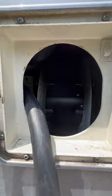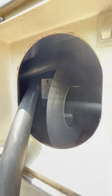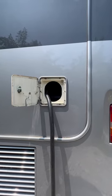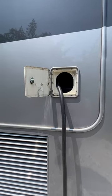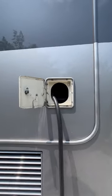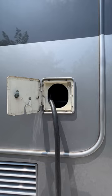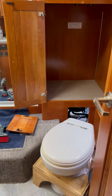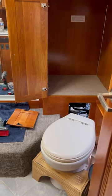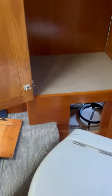I'm going to have to go inside my coach to show you how I access mine. Most of them are in little bays — my water reel is in one of the bays and that one is starting to click, so I'll have to replace that gear as well. The only way to access my power reel for my power cord is in the rear bathroom. There's a little access panel right here that just pops right off.